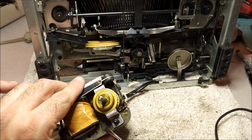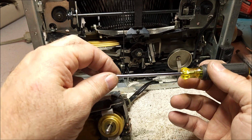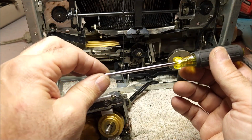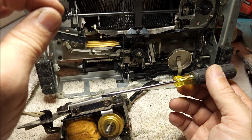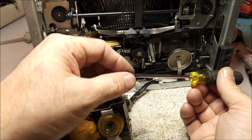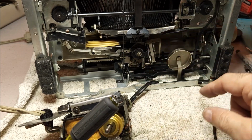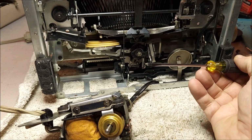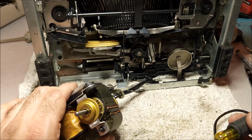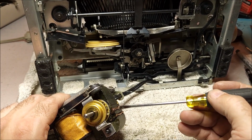So in a single phase motor, you have a magnetic field forming in the transformer, and that rotates as the voltage and current goes up and down. If things are in just the right position, when that turns on, the motor won't move. It'll just stay. Think of your air conditioner or outdoor fan, the fan blowing the wrong direction in the presence of the wind, and you put the power to it, it will keep going that direction, even though it's the wrong direction. In order to make it go the right direction, you have to have something providing a magnetic force pulling the motor in the correct direction. And that is what these shaded poles here are for.